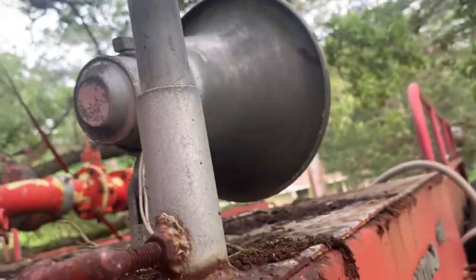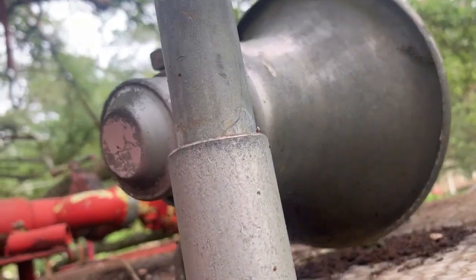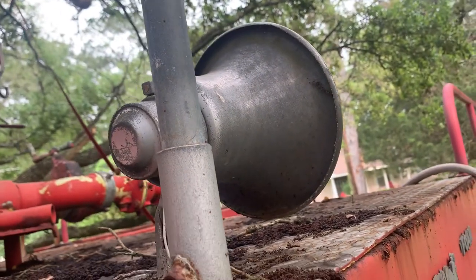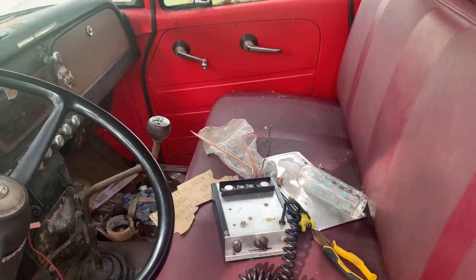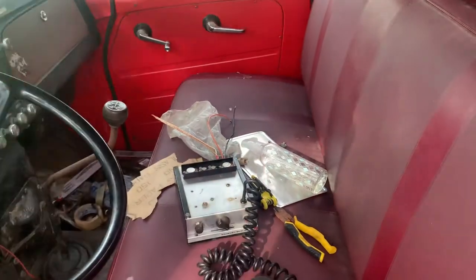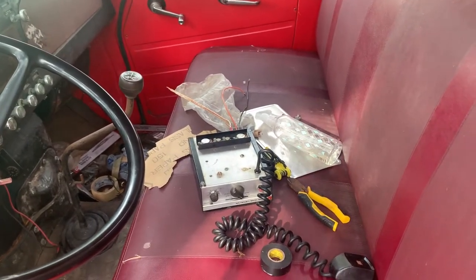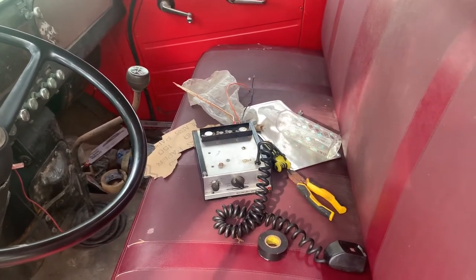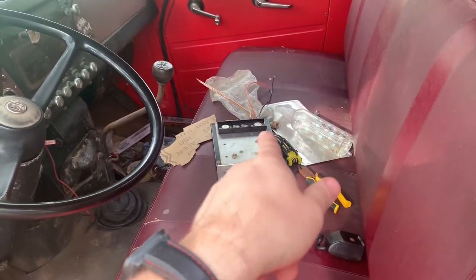That poses another issue — we've got these speakers here which I'm probably going to just remove. I don't think there's any reason to keep them; they're 10-watt speakers, so they're not very powerful and not going to be enough for this siren. I've got it hooked up for 58 watts right now, and if I try to run the siren off of it, it's probably going to blow these speakers. You can wire this thing up for 58-watt or 100-watt speakers.